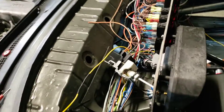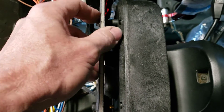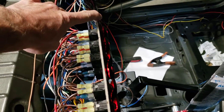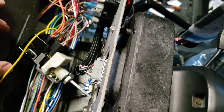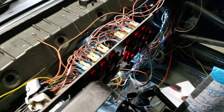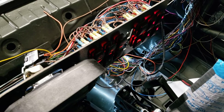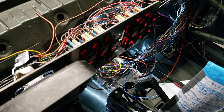So the mount — what is the mount? It's literally four pieces of carbon fabric with a core material in between. Four pieces of carbon with that core material — it's extremely strong. It's only held in here with two bolts, but when you consider the rigidity of that board with what's in this material, it's very impressive. The mount — I used a fiberglass veil on it per the suggestion of my carbon supplier, but I don't like it. It left some white spots in the final product, little blemishes, whereas a carbon veil would have made it a nice glossy finish.